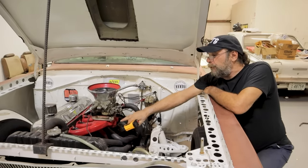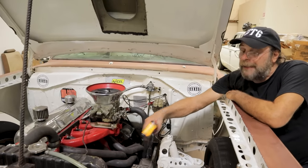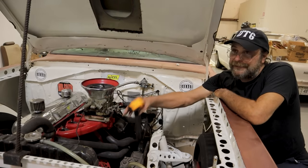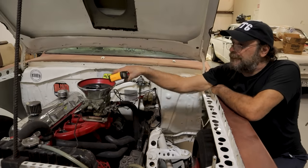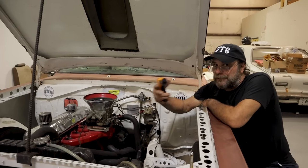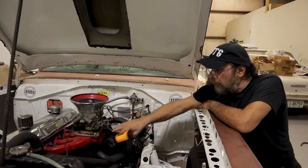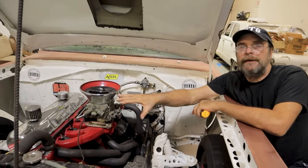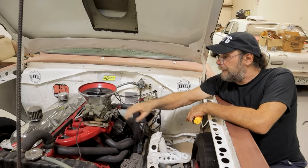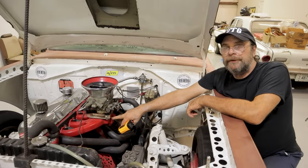Now that's what we have to do. We could take a shortcut and add a heating element to the bottom of the carburetor, but I'd rather — for this Saturday — let the engine run and monitor temperatures before pulling into the lanes. If we get to 150 degrees, our bog should be gone; we should be able to drive it off idle, lay into the gas, and have the car work the converter and pull. I'm afraid that if I add a shield or tie header heat to the bottom of the plenum, I may go too far — we want to maintain minimum heat necessary to do the job. If the whole manifold gets up to 220 degrees matching the rest of the engine, it's going to be too hot and we won't have that rich, oxygen-rich, dense, cool mixture. Our only goal is that when the accelerator pump dumps fuel and it hits the floor of the plenum, it vaporizes and acts as the fuse to pull in the rest of the mixture.